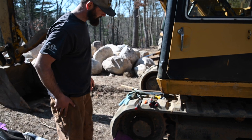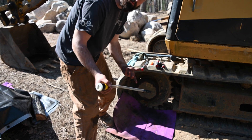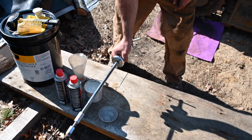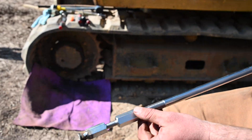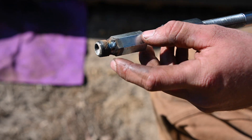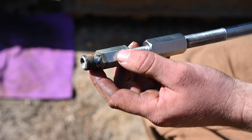There's a little hammer, your fill tube to fill it in there. You're going to need a slide hammer. This is kind of a custom setup — this is a coupling to fit my slide hammer. Whatever threads are on your slide hammer, you need to find the coupling that's going to fit. And from there, you're going to get 3/8 pipe thread welded on that coupling.